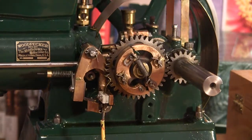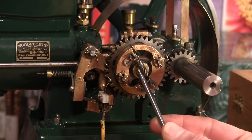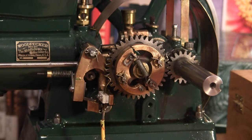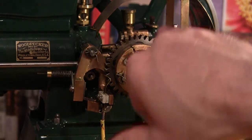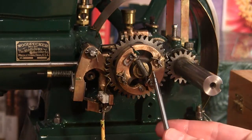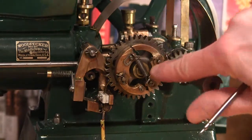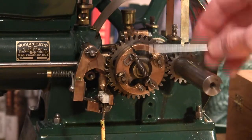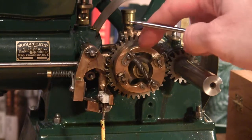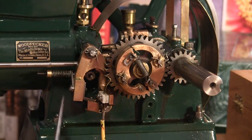There are a lot of adjustments on this thing. Don't get the springs too loose — you want them fairly tight. There's a lot of force generated by this spinning, and the centrifugal force will expand that spring quite easily. You want to make sure this spring is tight enough to pull this back in alignment, because if it isn't it may fire a couple times and be inconsistent — you aren't going to be able to get it to run very well.